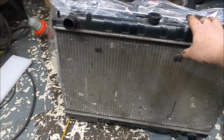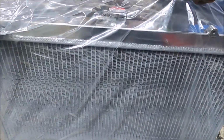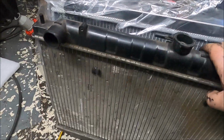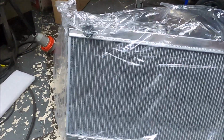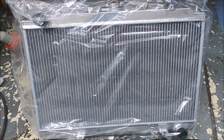Obviously, SR20 radiator going in that. But obviously I weren't going to use the standard one. I got this one. Literally a Chinese aluminium one, but honestly the quality is fantastic. I think this was 110 quid delivered, something like that. It's pretty hard to go wrong. And more to the point, while it is bloody good quality, the core is pretty much double. So it's double capacity, great quality, obviously easy to TIG weld to modify, because it does need modifying slightly for this application because it's aluminium, and it was like 110 quid, so winner.